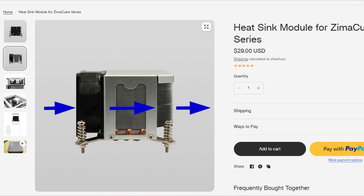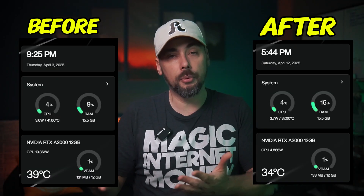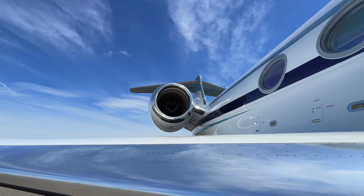I cleaned all that up and applied my own thermal paste instead. When you put the new cooler back on, be mindful of direction because air flows over the fins. I opted to spit heat out the front of the device, since the fans underneath that blow air over the drives do the same thing — I didn't want to suck in hot air from the drives for the CPU intake. After applying the thermal paste and putting it all back together, the temps were actually lower than before the new cooler was installed — not by much, but a couple of degrees.